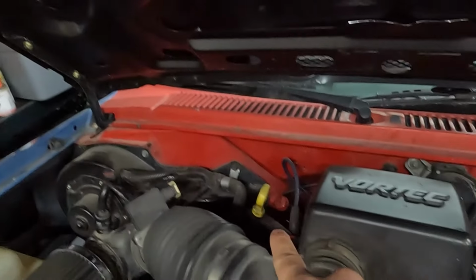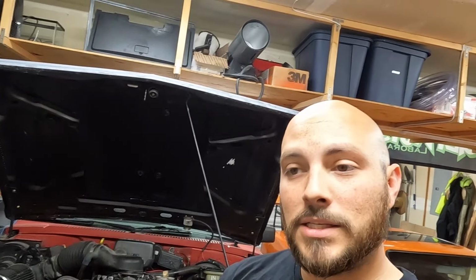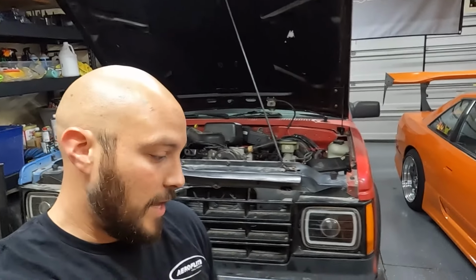is way back in there, I cut the harness and I gotta find the 4 wires for the driver's side O2 sensor. The passenger is hooked up. I'm only doing the first banks because I'm not gonna do a catalytic converter, and I'm gonna get this tuned out so it runs and drives good. We'll get started on that.